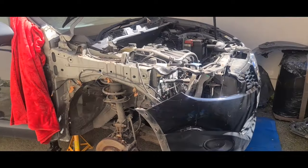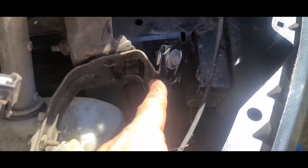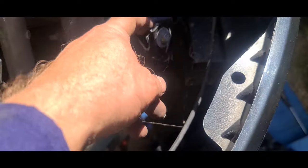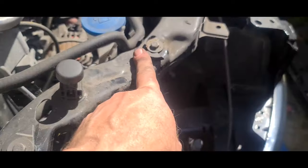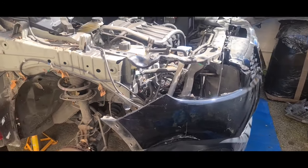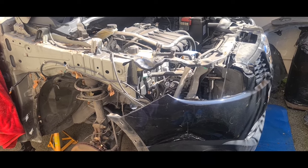We are making some progress now. The wing is off and we can see exactly what's going on damage-wise. There seems to be a bit of a bend in the headlight bracket — that shouldn't take too much to bend back round. Apart from that, all the sockets and plugs look fine so far. There was a little bit of a crack in one of them, but it looks like we've just got to bend this back round. We'll take these original headlamp retaining bolts out and then offer everything back up and see how we get on fitting the new parts. When you start fitting the newer parts you'll see exactly what's out of line.